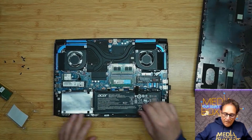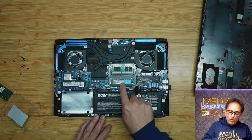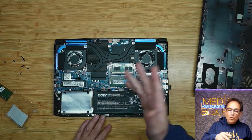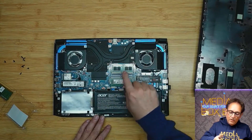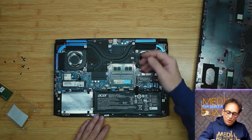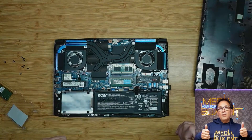Okay, that's it. Make sure you push it all the way to the front when you insert the memory. You'll see one goes this way and the other one is upside down — one with the name of the company facing up and the other one facing down. Make sure you push it down. It's pretty simple. So at this point we're done — we're going to close it up and boot into Windows.